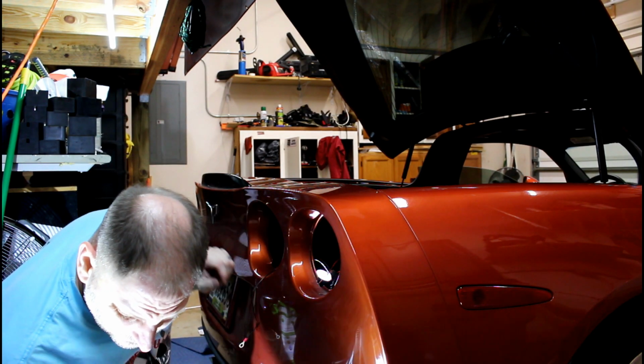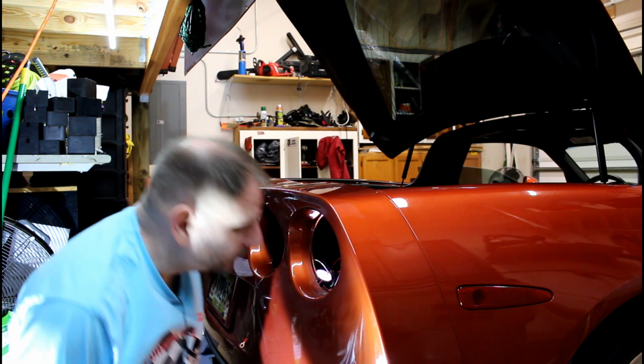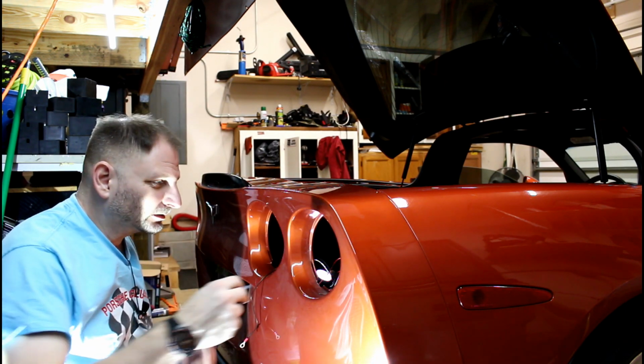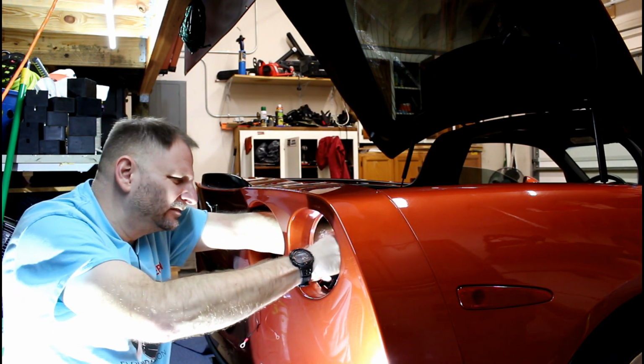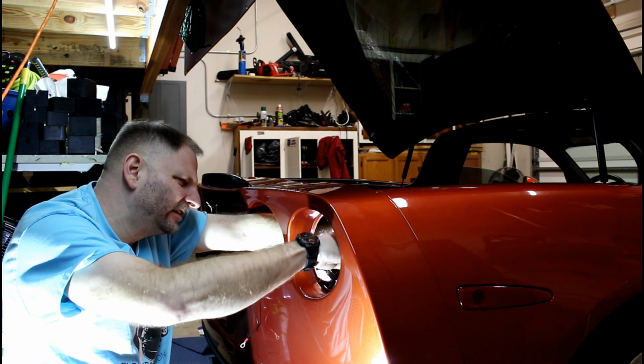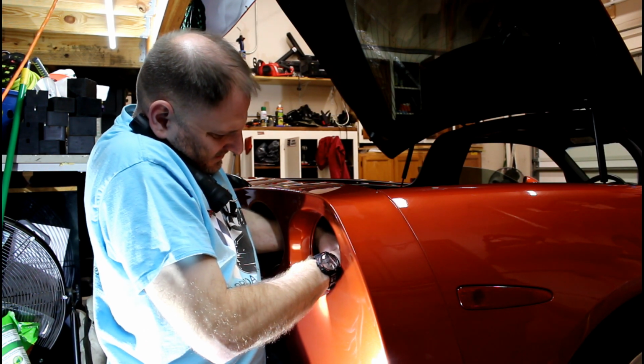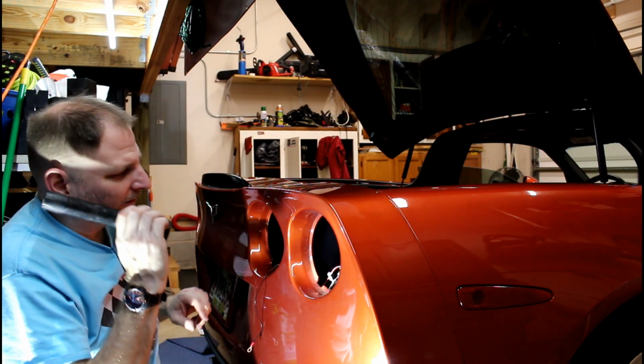Oh, before I jack this up, before you crimp your second crimp and put the wire in, make sure you put your insulation sleeve over it, your environmental sleeve. Pull test good. Okay, we'll slide our environmental sleeve on. Just in case I didn't get it,